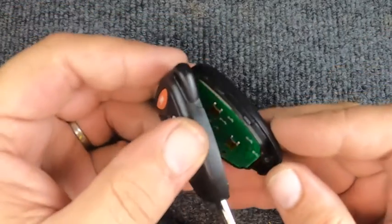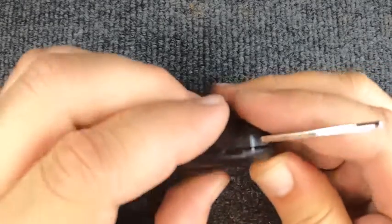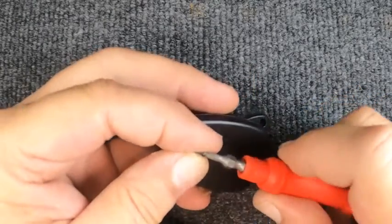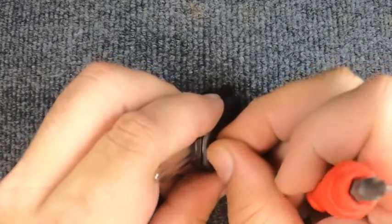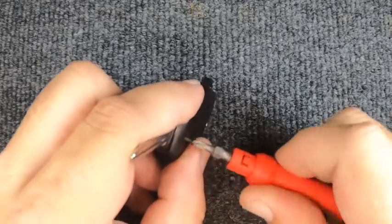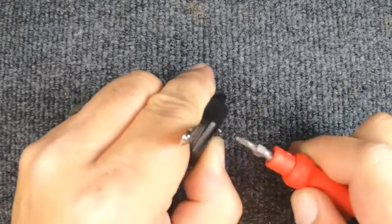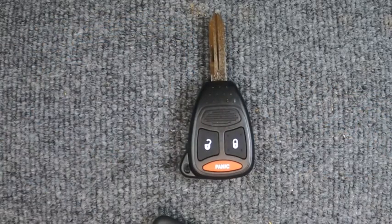Now take this part of the remote housing and join the two together. Just gently squeeze around it — it's latched. Turn it around and put the Phillips screw back in. I'll show you a little trick: since these can cause issues and risk stripping out the housing — not the best design by Chrysler or Jeep — when you get close to the end, I like to squeeze the tip of the remote so the key and screw aren't doing all the work; I'm putting the pressure on it. Now it's sealed up — there you go, you've just changed your battery.